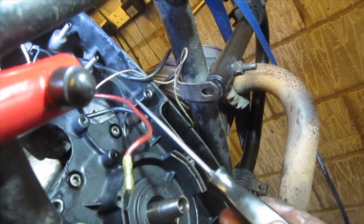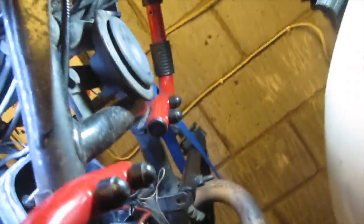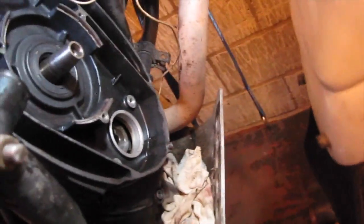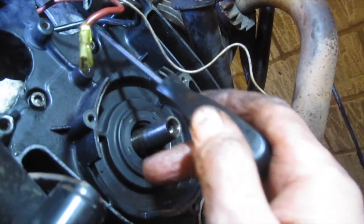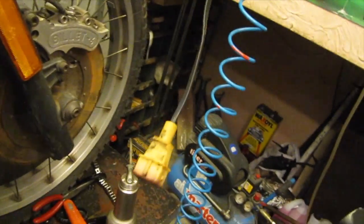I've got the cables for the B terminal on the diode board. I've got two. On the standard system you only have one. You've got this cable here that's got to go on the back of the diode board, that's the blue one. We've got this, this is my points cable, but as most of you will have a bean can Hall effect trigger, you'll also have a cable hanging down, which mine's tucked up away inside the starter housing, but there's also the cable that goes on the bean can. This is the other connection of it. That's an electronic ignition bean can that I've got on the bench. So remember that it's got to connect up to its connector up inside here. There's a multi-point connector in there.